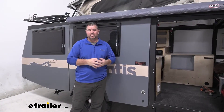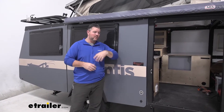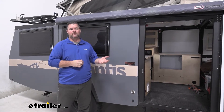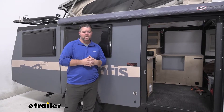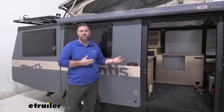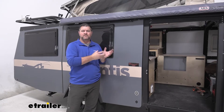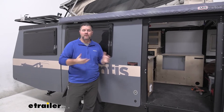What would be the purpose of using tank heaters? Well, the main purpose is to keep your tanks warm enough so that the water doesn't freeze, so that you can empty them or add water in when you need to. For instance, if you're camping in cold weather conditions, if it's open on the bottom and your camper is not set up for cold weather conditions or it doesn't have a winter package on it, your tanks are open to the weather, so you get a lot of wind that may blow under there. If it's freezing, those tanks are going to freeze because they're made out of plastic. Adding these on keeps the water from freezing inside that tank, so if you need to empty your black water tank or you need to add water into your fresh water tank, you're able to do that.